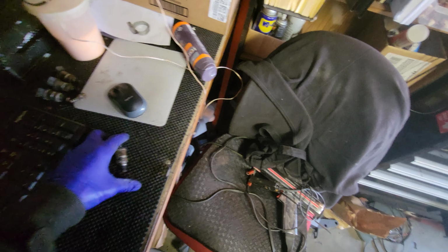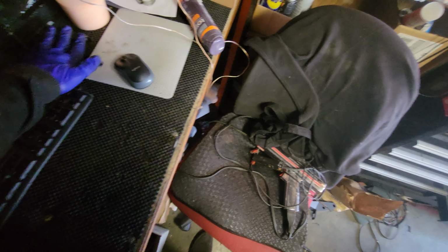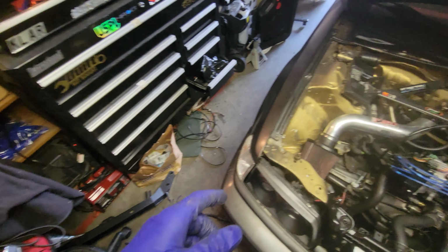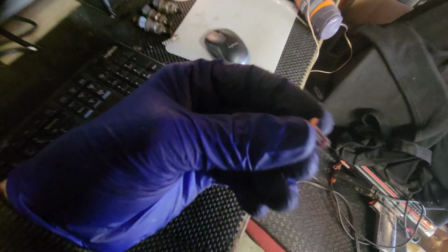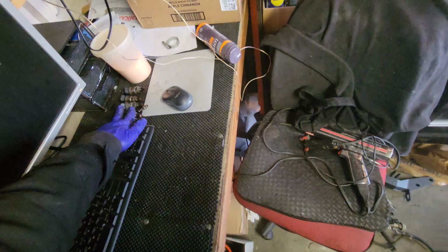At this point, I'm on like the 7th pair of injectors that I've been juggling, generally like three pairs at a time. So I know that I have the A6 SI ones right here, which are, I believe, 235 cc. So those will be an upgrade. I got a tester and flow kit coming so I can clean them and test them. I also have a kit with all brand new filters and O-rings and stuff, because these filters on here are definitely, they've been had. There's some stuff in there. So anyways, I got the rebuild kit for those coming, plus the tester,